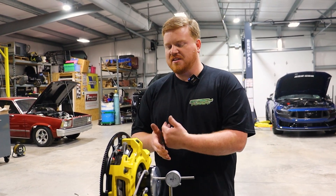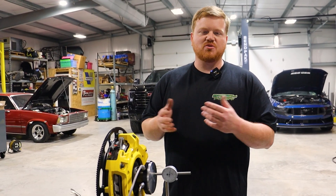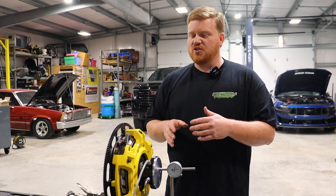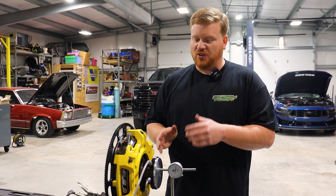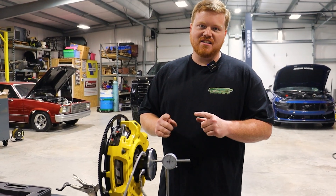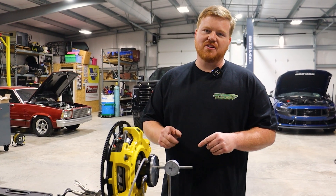And to avoid that, we recommend shimming. All it does is tighten this tolerance up, because it's a very loose tolerance from the manufacturers — they don't check this stuff when they put it together. They get everything close enough and that's how it goes out the door. When we assemble stuff like this, we're making sure that you're getting an optimal setup. It's meant for longevity, meant to make sure that this thing works as good as it can, as flawlessly as it can, for as long as it can. That is the intent of shimming a release bearing. You will not gain travel by adding a shim.